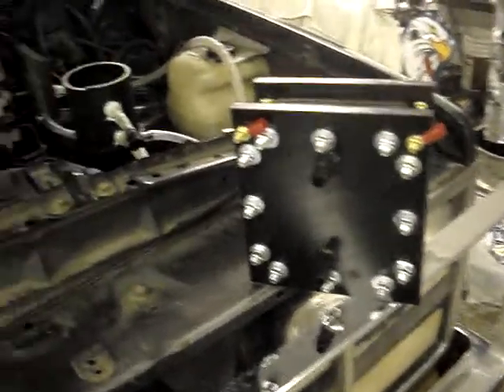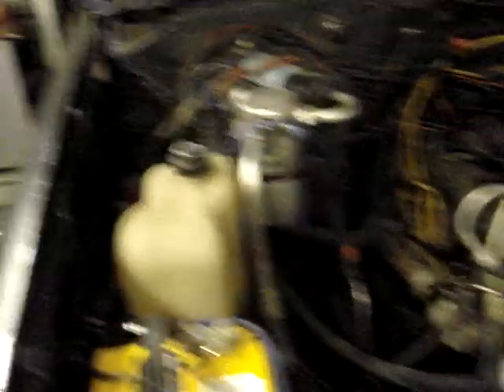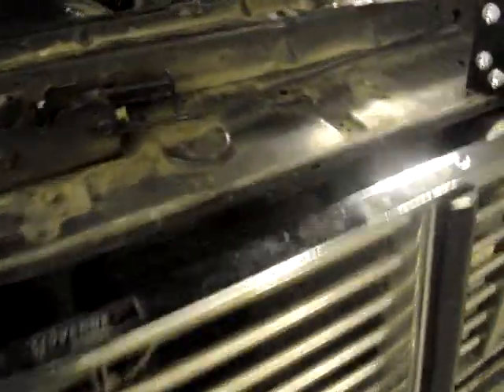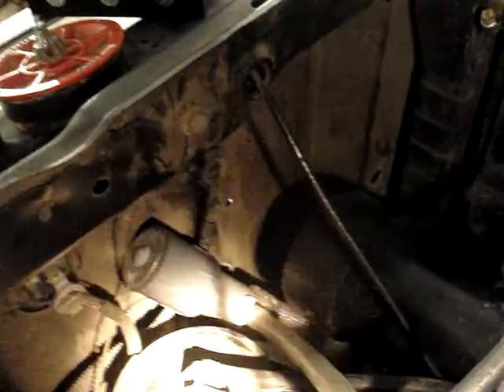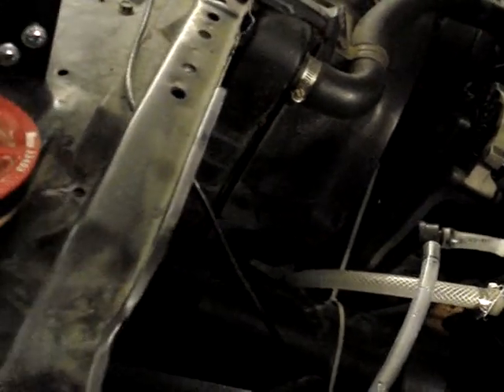There are some cars that will fight you tooth and nail, especially your newer ones — they don't like this. The Suburban has no PWM. You can see down there there's an 80 amp continuous duty relay, 4 gauge wiring. The cell is mounted underneath the bumper. It's a very crude reservoir, but it holds just about 3 gallons. And my flashback arrestor that you saw in the video is also down in here.